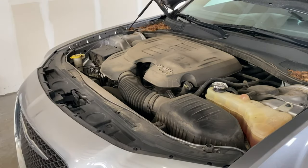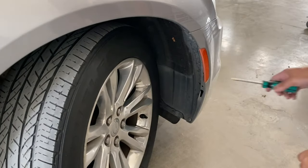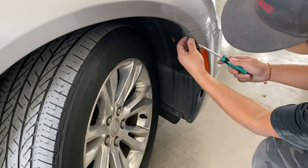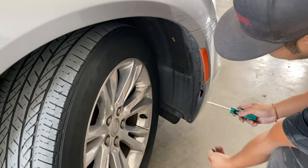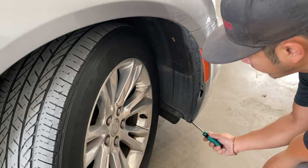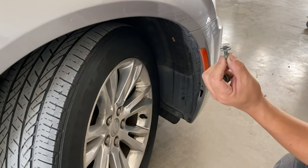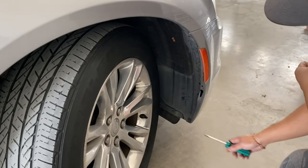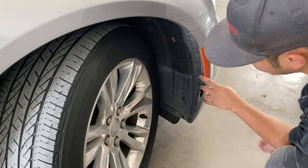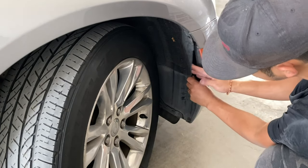Now I'm going to move to the side of the bumper. All right, so again, get a flathead, get these push pins out of the way. That's one, there's two right here, and then a third one right here. Pretty hard, but intact. So I'm gonna go ahead and put that to the side, but then when you get to the fender liner, go ahead and push it to the side,